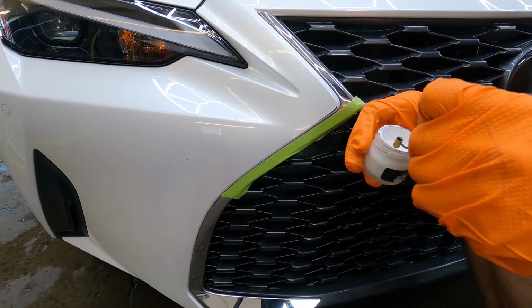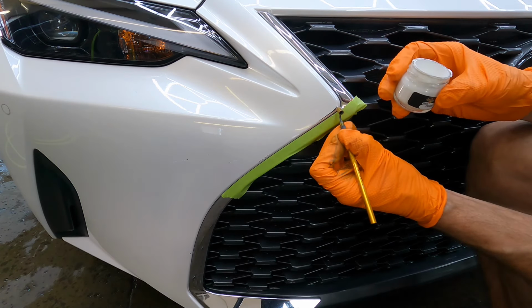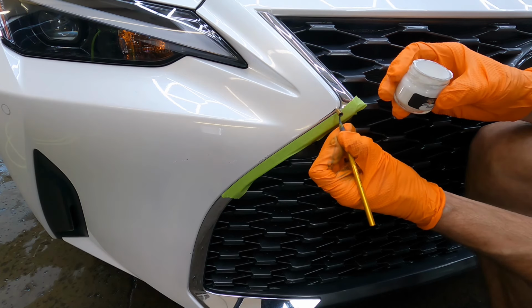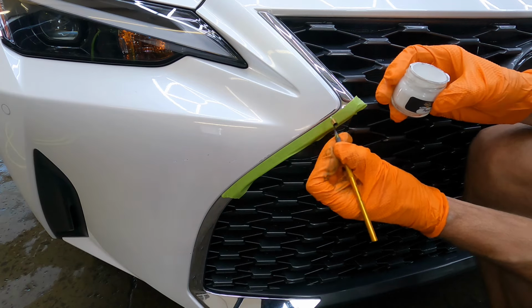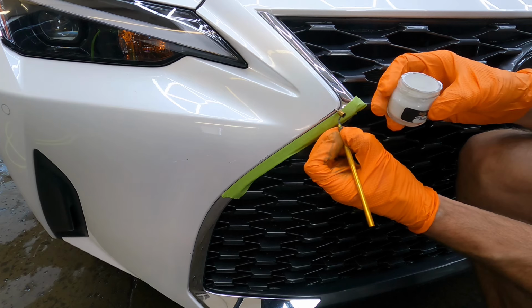The areas that are peaks and body lines, it just had some of the surface scraped away. It only takes maybe 1 or 2 coats. If you have a gouge and you want to use that base layer to fill in, it may take multiple applications of the base layer, let it dry, and come in and fill it back in until that valley is leveled up a bit.